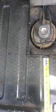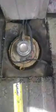And to do that, I have to drop the tank probably about 4 to 6 inches. Sawzall or angle grinder. I used an angle grinder because the blade would be shorter. I was worried about sparks and stuff, but it's right there. Literally, all you gotta do is unplug that one, unplug this one, unplug that one. And these wires go back under the Jeep. Go under here. I've had no issues since I've done this though.